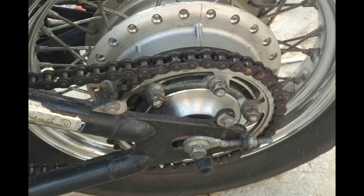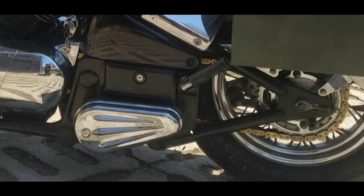That was a rear arm stretcher, but it screamed at high speed. Obviously, that changed quite quickly. As of 97, all bikes, A's and B models, so the classics and the Softail standard lookalikes, had 17 teeth up front and 42 teeth in the rear, which was a good middle ground, but still fairly buzzy above 70 miles per hour or 110 kph. Now the drifters had 17/40, so they had a bit taller gearing.